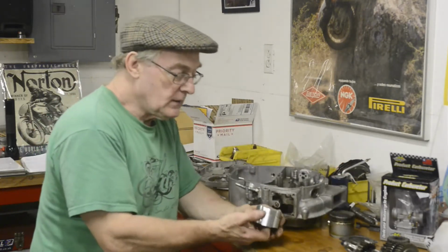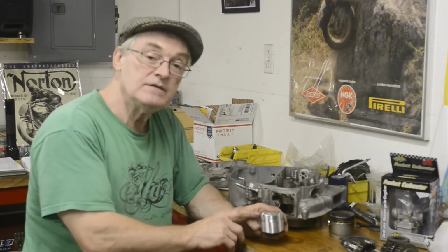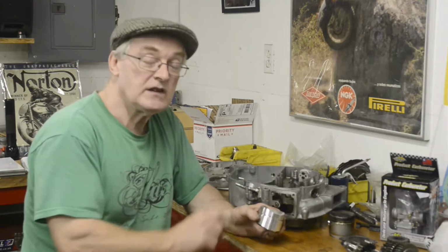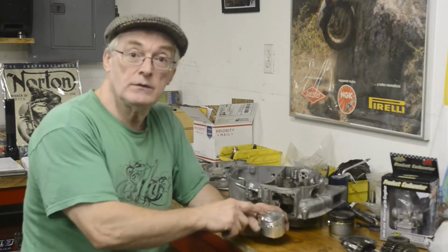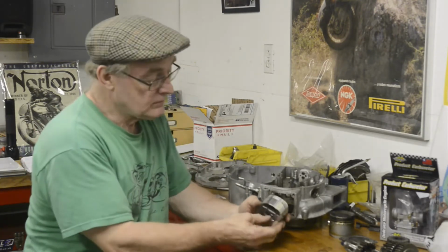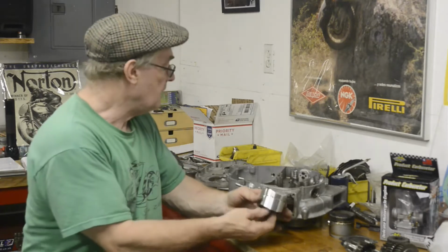But there's a chap in the US called Ed V. I can't remember what the V stands for. JV Engineering. And he tunes B25s for flat track and things like that. And he does, I think it's a 12 to 1 piston for them. But it's got a really solid crown. So I give him a call and he just machines the top. I could do it myself, I suppose, but why bother? He does it for me and the piston's the same price. And it comes out at 8.5 to 1.